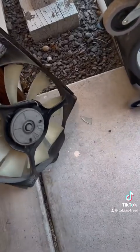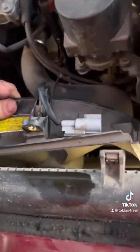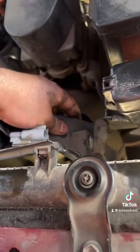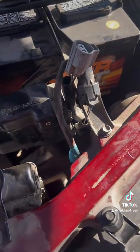So when you pull these out, just be mindful of the fans there. Set them aside for now. This one, there's also another plug, counter to this one, right down there. So it's easier if you just slide this over. Now see how simple it is to get to that plug, and this will slide right out. Right after you pull those, set the plugs to the side.